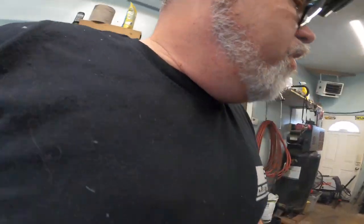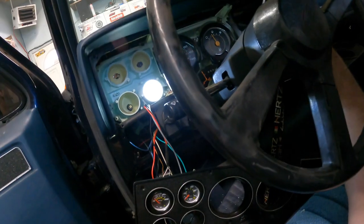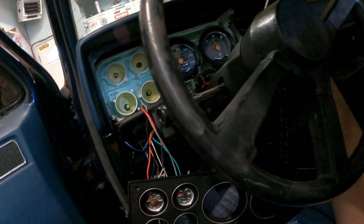Now what we need to do — I should have checked the oil pressure real quick. Let's check the oil pressure, see if we're getting oil pressure. Do we have any oil in the line? I don't see any — probably don't have any oil pressure. Let's check one more time real quick. Here we go. 30 pounds at idle. That's pretty good.